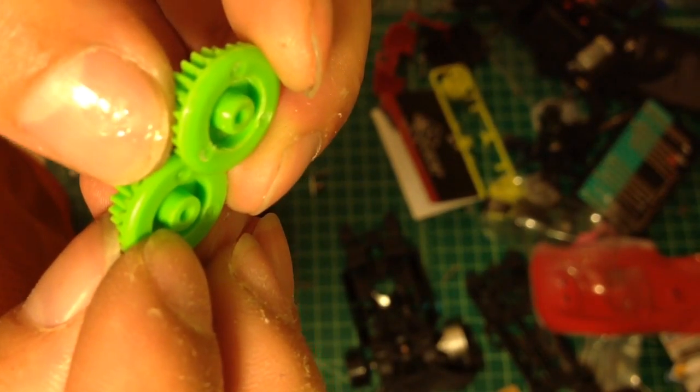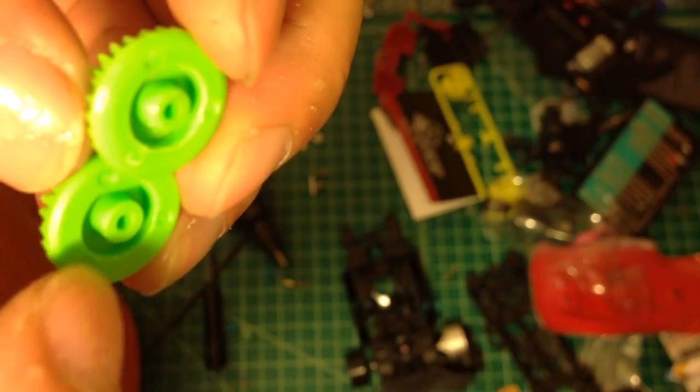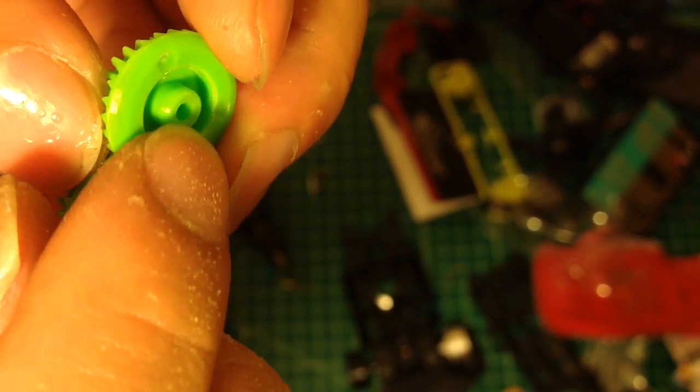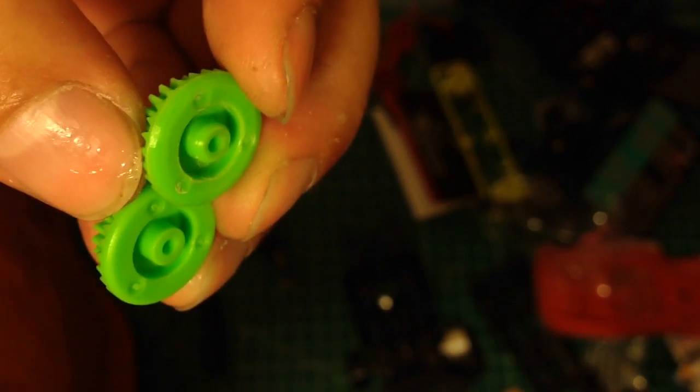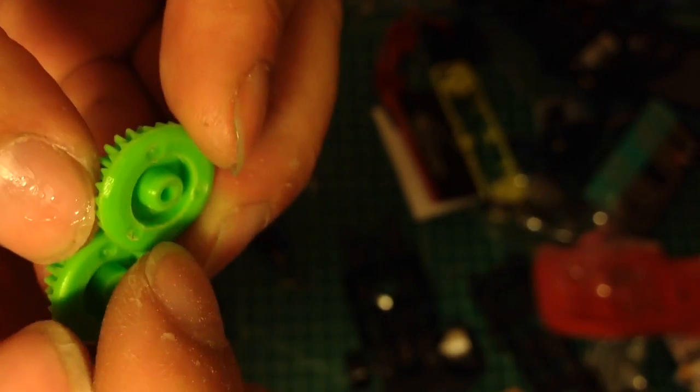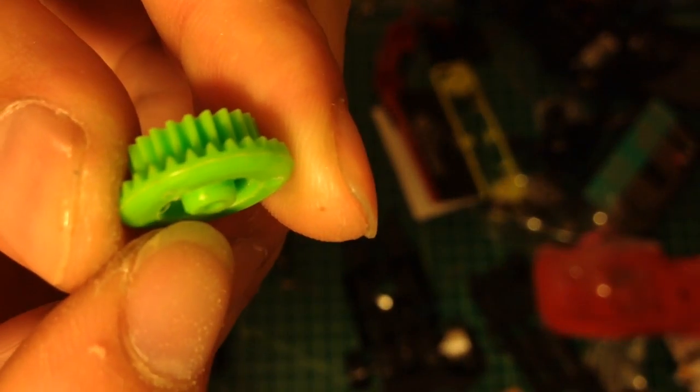And this part right here, the original one, the contact surface is all keep contacting, it's just too big. So when you make it smaller like this one, it gives you better friction and reduces a lot of resistance. So the counter gear and the gearbox will spin faster, because the contact surface right here is getting smaller.